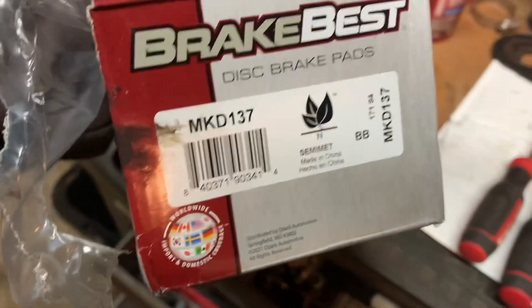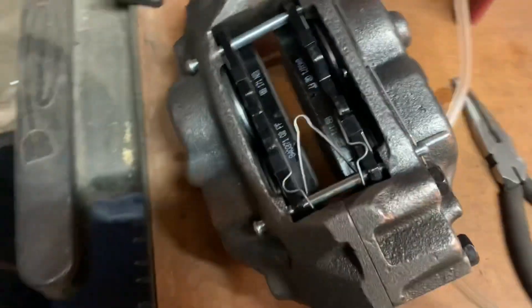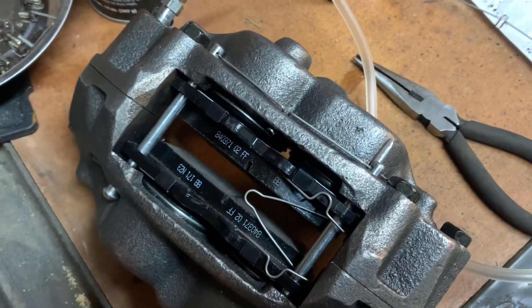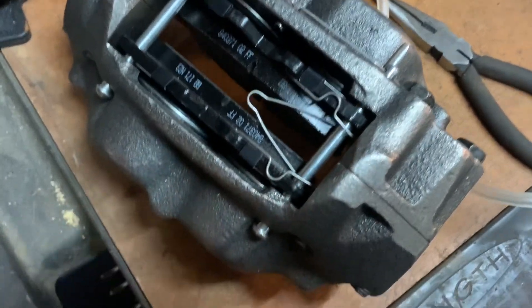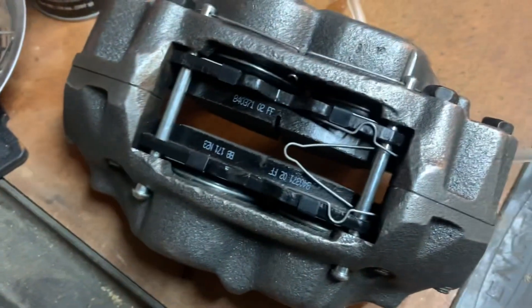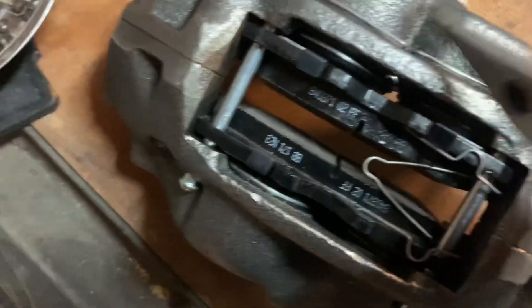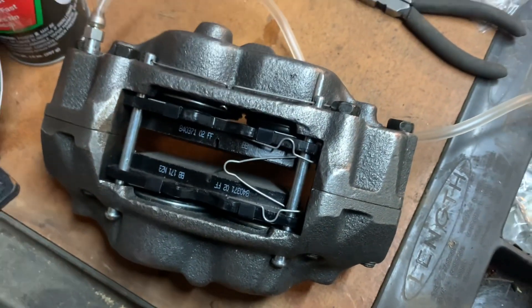So I'm going to go ahead and just do that. It came with all the pins. These are the brake pads that we're using here - they only had two different types in there, but anyway that's the ones I got. Just a quick look at this - I'm obviously going to put the caliper on without the brake pads in it first, get the brake line hooked to it, get fluid started in it, then put the brake pads in. I just want to give you a quick look at what these pins and springs look like and how they go in.